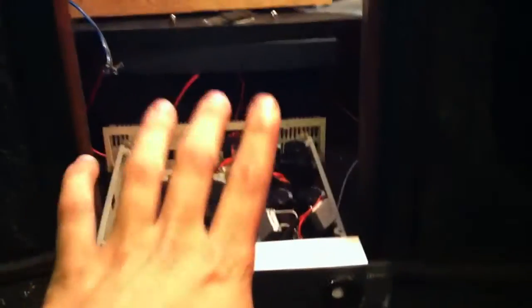I think I blew the crossovers in them, because I get really high-pitched whines from this tweeter and a fuzzy noise coming off of this side over here. Because I played this thing at full volume with this amp running off a laptop, the input voltage was probably enough to spit out an easy 20 watts into these. These are rated for 20 watts, but that was when they were new, and they're not new anymore. Plus, these are supposed to be sealed and I have the port in the back open and was running them like that. The crossover caps are only rated for about 10 volts, and this thing spits out between 13 and 14 volts at full volume. So I more than likely did something with the crossover.